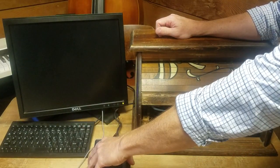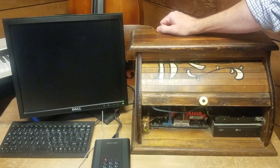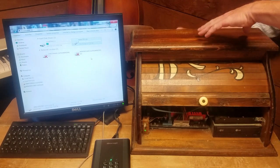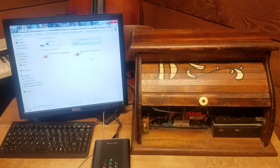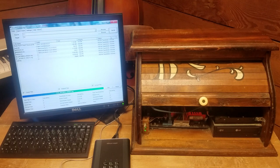DD has finished and we have the compressed image on the iStorage. I'm going to make one more backup that's a bit more friendly for the customer to just access their old information, and I'll do that straight from Windows. We unlock the diskAshur DT2 with the user PIN we created earlier. I'm going to put my flash drive in and use a freeware program called Unstoppable Copier that I have on this flash drive — I'll just take the whole C drive and go. Off we go, we'll just let that run.